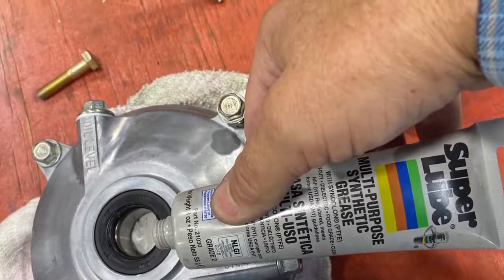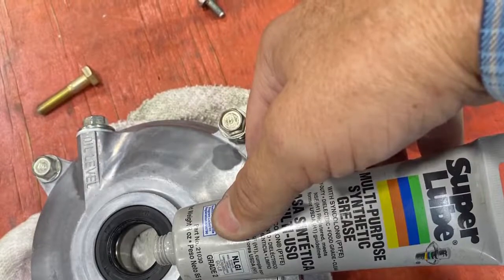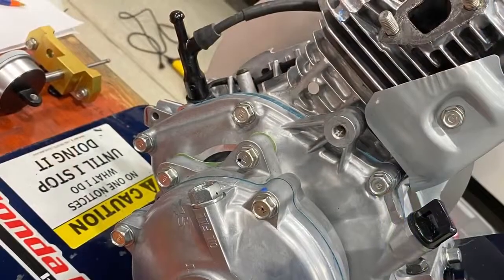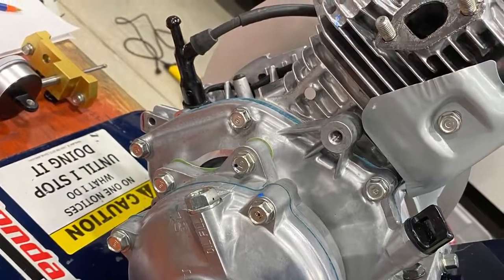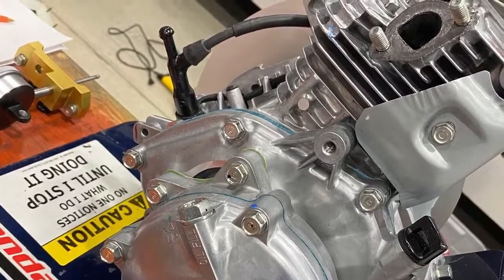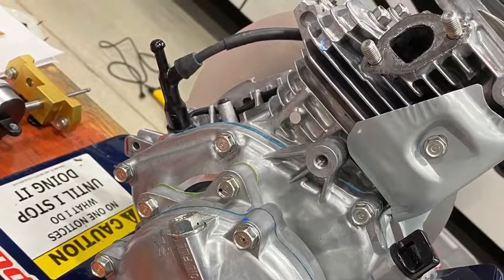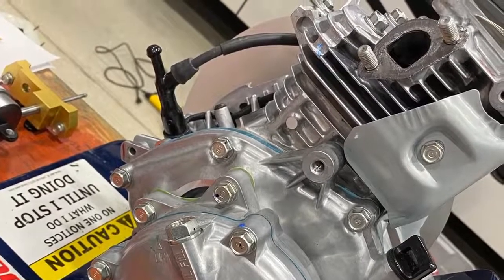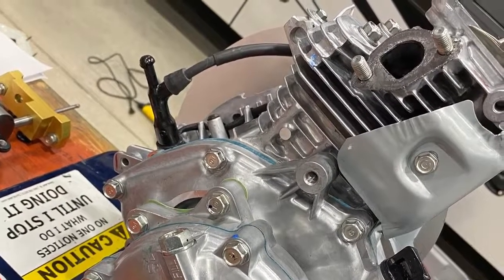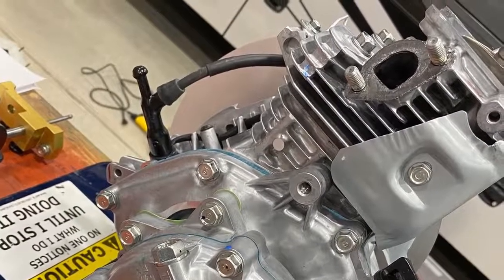In the next slide here, we are showing you the finished product. With the engine mounted back on our stand, we have the gearbox all back in place. It takes 3.5 ounces of transmission oil — you can use the Delco oil or the Ford transmission oil. 3.5 ounces is the amount. You'll bolt your gear hub on and you'll be all set. It's not coming off. Thanks for watching Crybaby Performance.